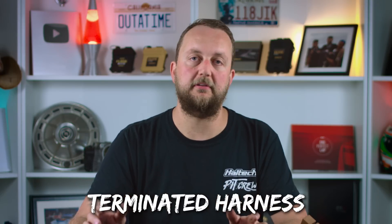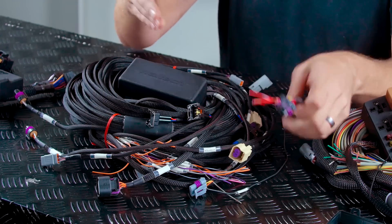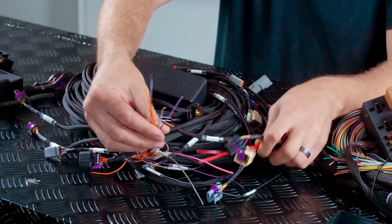This is a fairly complex style of installation and does require a fair bit of labour, so if you're lucky enough to have an engine that we make a terminated harness for, it's a great option. It's a fully terminated engine harness that plugs into all your factory connectors — you just need to connect the power, the ground, the ignition and she's ready to start and run. We do leave extra inputs and outputs in the loom for added flexibility, because every installation in the custom world is not going to be exactly the same. This also has the integrated fuse box assembly. When ordering, make sure to match the exact engine you have with the terminated loom descriptions, as some manufacturers change connectors and sensors frequently.